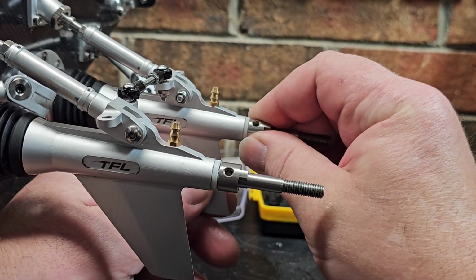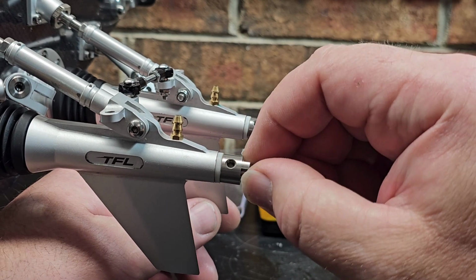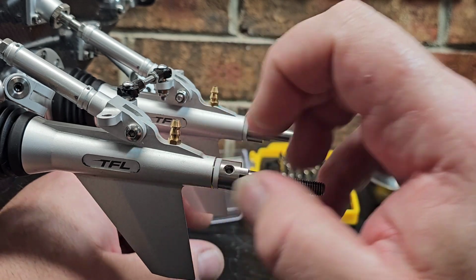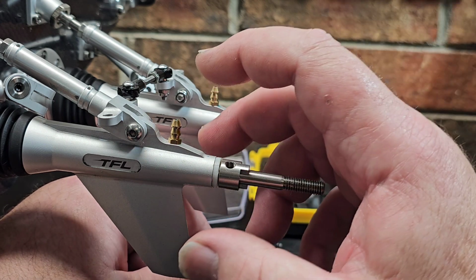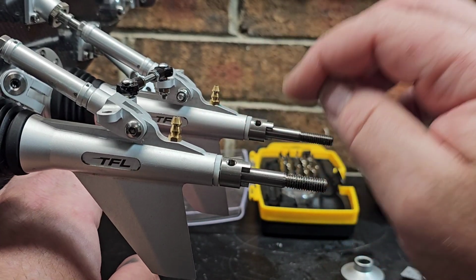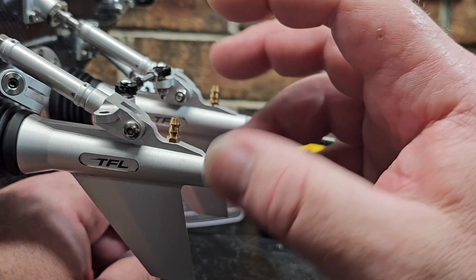So you want about 1/1000th of an inch, you know, a little play there. You don't want them butted up, because Teflon will deform. It'll heat up with a lot of friction and flatten out, which is what it's made for. So it's not metal on metal, it's metal, Teflon, metal, and it's not going to damage your drives